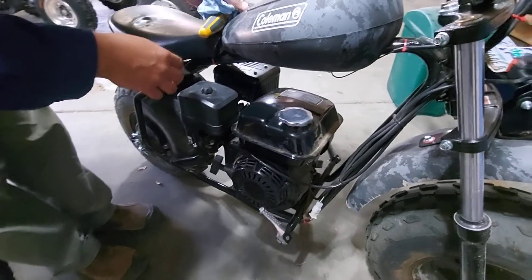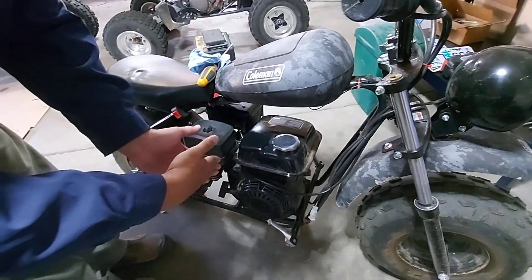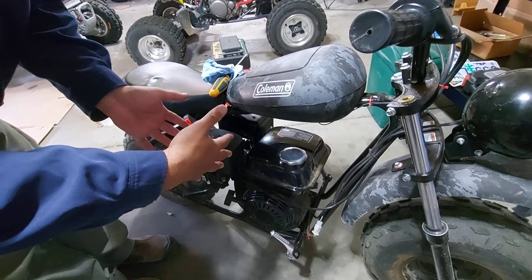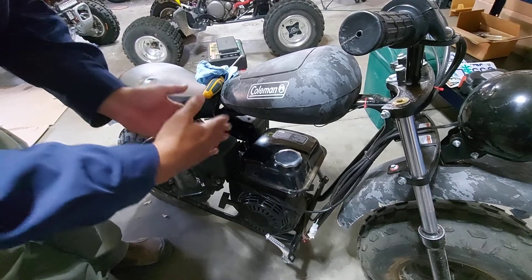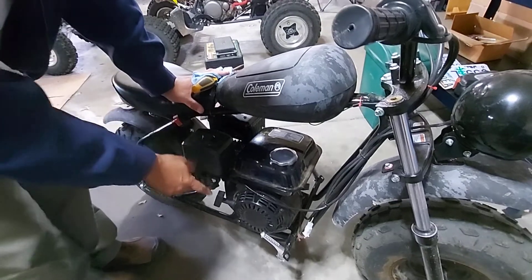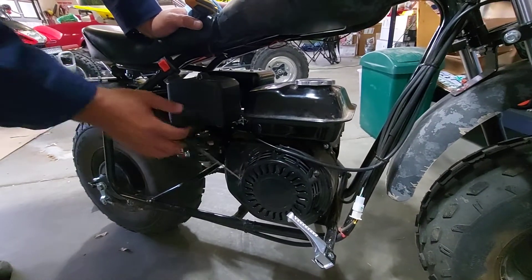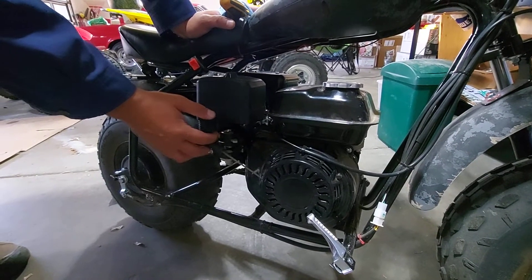How hydro lock works: think of the piston pushing — it can push air out, push the other gases out, that's what makes the thing move. When you fill that up with something liquid, something thick like oil, those pistons can't push. So it's hydro locked. How you find out the hard way is the bike will stop, and when you go to restart it, it'll go and usually lock right there. By locking, I mean you can pull as hard as you want and this thing will never move.